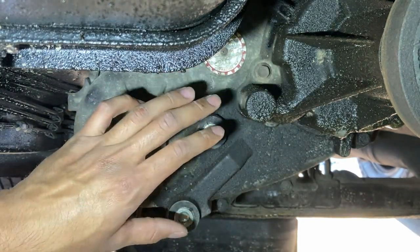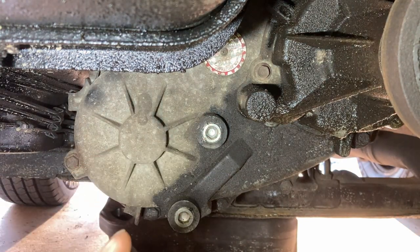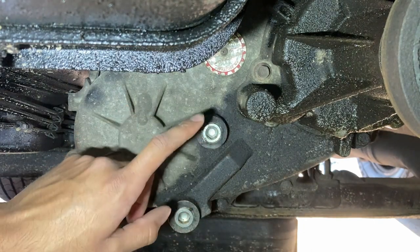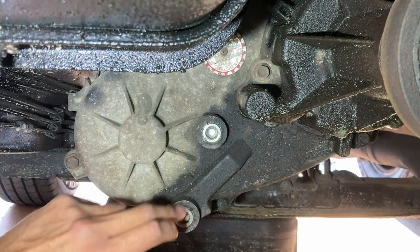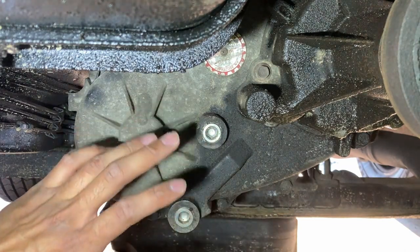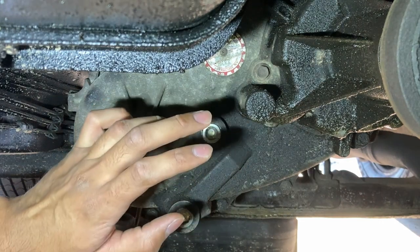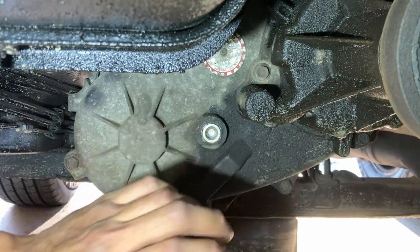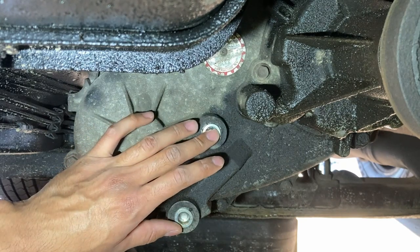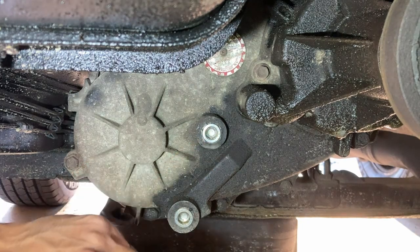Normally on the factory plugs you're going to have 10-millimeter bolts. When I first bought the vehicle, I drained it and put the incorrect fluid as mentioned. I also replaced the plugs with aftermarket ones because the originals were completely rusted and eventually would have stripped — which would be a real pain to deal with. The new aftermarket plugs are 12 millimeters, whereas the factory ones are 10 millimeters.